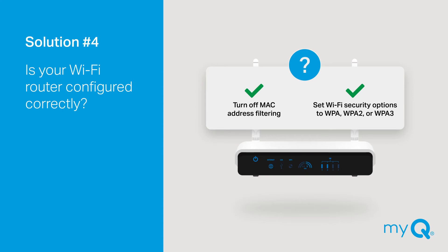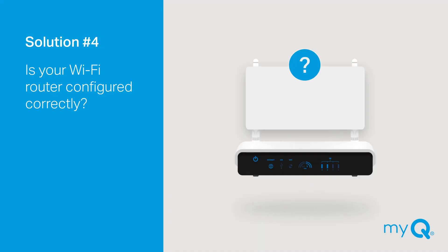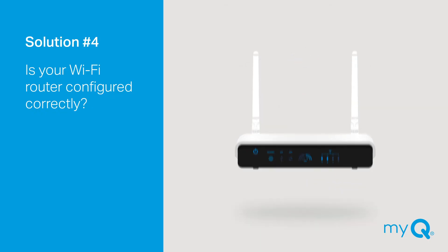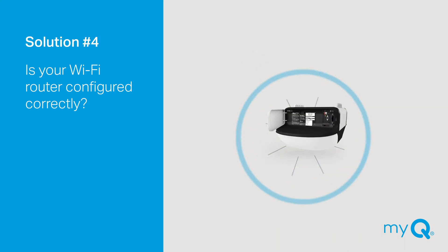Your MyQ enabled Wi-Fi garage door opener is also not compatible with WPA Enterprise. If the light on your MyQ garage door opener is still blinking green instead of solid green, simply unplug your router and MyQ garage door opener. You will need to remove the connection to the battery backup and then plug them back in. If that does not resolve the flashing green light, it may mean that port 8883 is blocked in your firewall software. To fix this, look in your Wi-Fi router manual for admin page access and settings information.